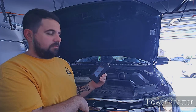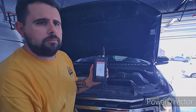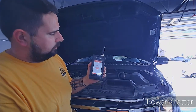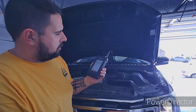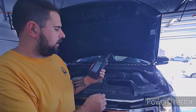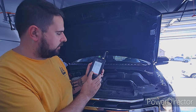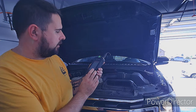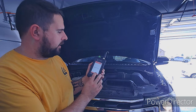Click Next, battery test in progress. It says it's pretty much happy for the most part — 50-ish percent, it's in the green. It's an almost two-year-old vehicle, I'll go with that. So I'm going to click on Next Test and do a starting test. Upon turning the engine off, select Next. Yeah, it's already off.